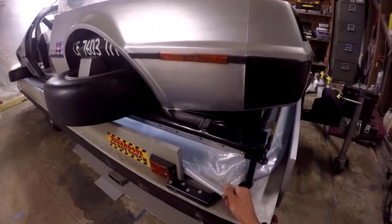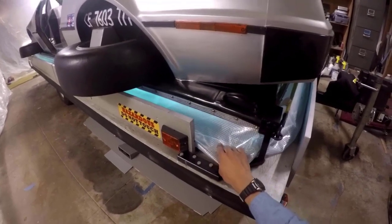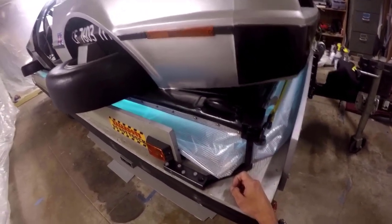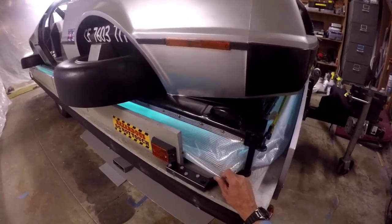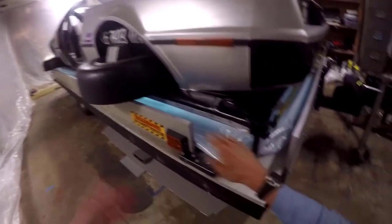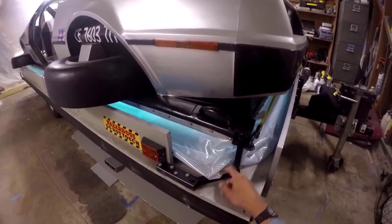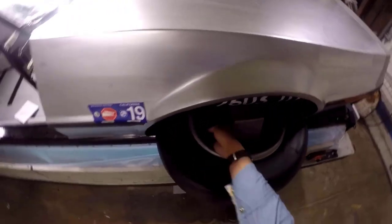This is the new skirt. For years I had a skirt that was completely clear vinyl with no fibers reinforcing it, so you could see everything and all the light would come through — you can see in some of the videos it looks super cool. But it's dangerous because if a hole happens, it can spread and get really big and you lose hover power. So I made this new skirt with more translucent material — you can see through it but a lot of the light gets blocked by the fibers. It still lights up really well at night. My tires are held on with zip ties and I got electrical connectors that power the lights.